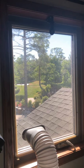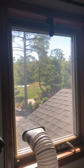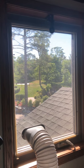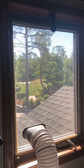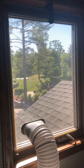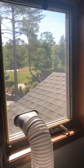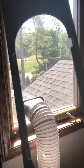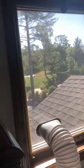As you can see, the screen is in place, so the first thing I did was take the screen out and measure it, and had a piece of polycarbonate cut at our local glass company that was the identical size of the screen frame. I also had the glass company cut a hole in the polycarbonate as a template for the receptacle that the vent hose goes into.